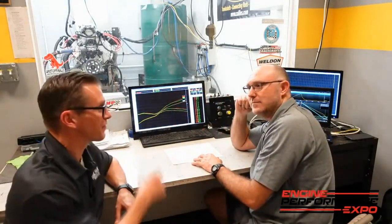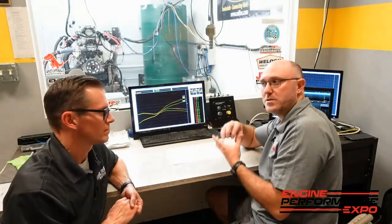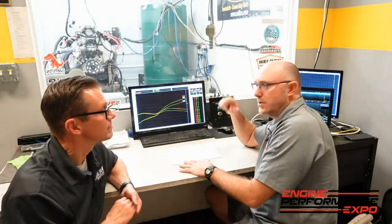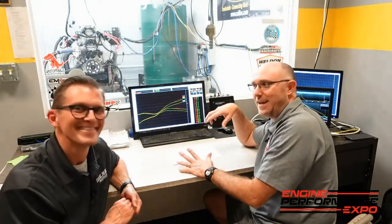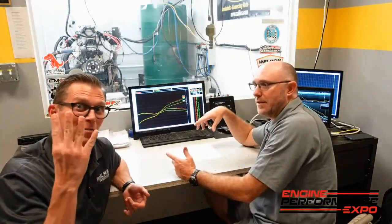Your results may vary with your engine, but for this engine, with what we just did, that's real. What's happening is all that extra volume of oil is sitting in the oil pan, and the crankshaft is swimming through it and slapping around. This engine has those big giant Bill Miller aluminum rods — way more surface area than a small steel rod might have — so there may be a higher penalty for this engine specifically. But no matter what, you're going to pay a penalty. This makes me want to put a dry sump on this engine and really see what we could gain — seems like there ought to be 60-plus horsepower from what we've just seen. Right hole, right place, right time, right amount — that right amount is tough, buddy.